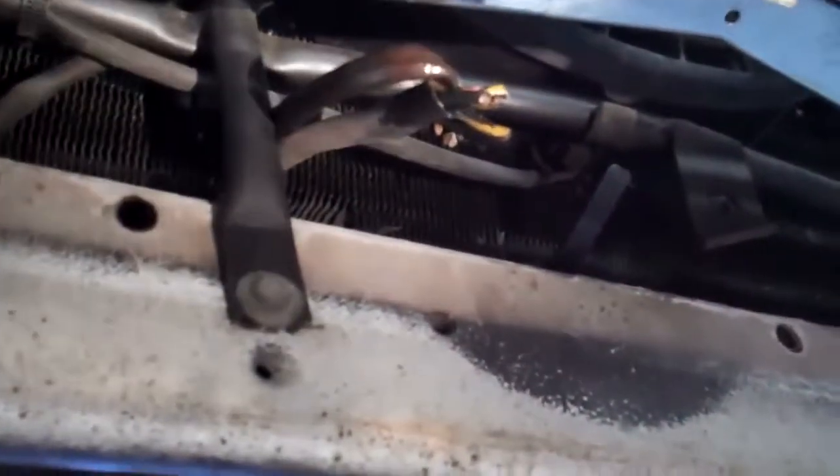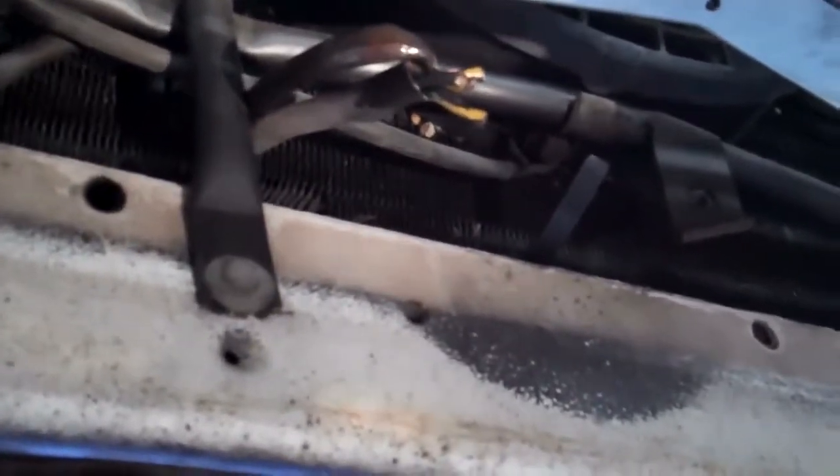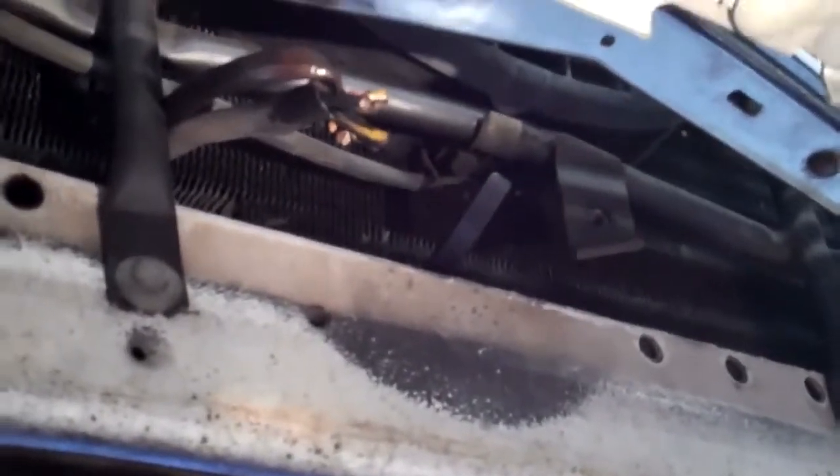These horns are rare, very hard to find, and they're expensive now, so you're going to need the original horns for this car. In the front area of the engine, this upper oil cooler hose is starting to sweat quite a bit, and I'm worried it could leak at any time. I recommend replacing the upper oil cooler hose — you can see it's uneven in one area, and that's probably where the leak will start if we don't address it soon.